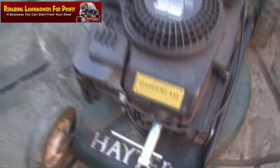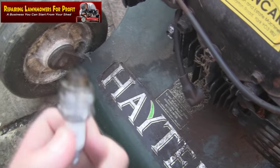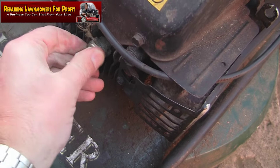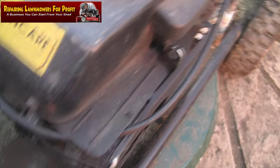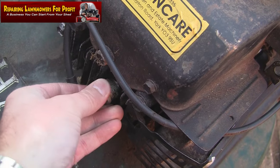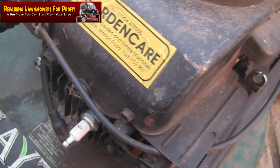The plug's really, really tight. See if I can get a bit more leverage on that — yeah, there's a little tip you shouldn't do, just give it a whack. There we are — lost the socket but it came out. Look at this plug — that's not bad, a bit of oil on it but pretty clean. Let's just give that a little dip in here and clean it off. I'm going to thread it back in. I already know it runs because it ran for like a couple of seconds. I might try another plug as well, but I'm sure it's fuel related — 100%.